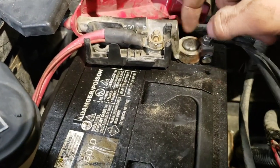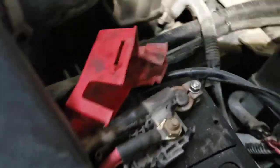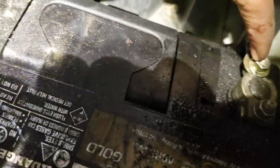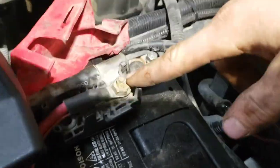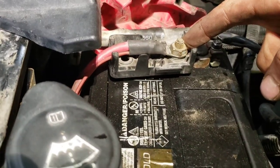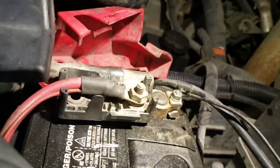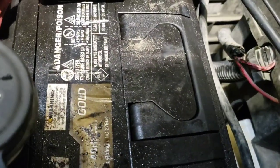With rapid clicks, I switched out multiple things. When I hooked up my harness to my battery terminals - ground here and positive here - these surfaces were very glazed over. So I took a file and just went at it, cleaned all the connections up very well, then reconnected it and it started working. Simple - it was actually pretty simple, just a bad connection.